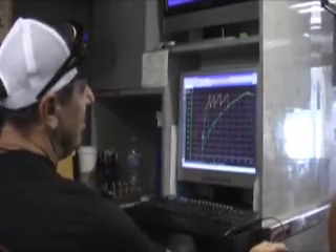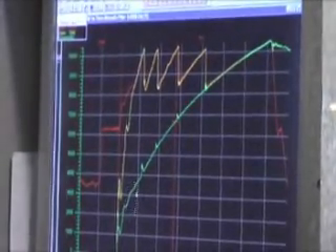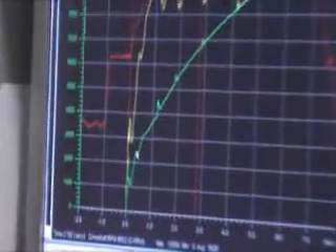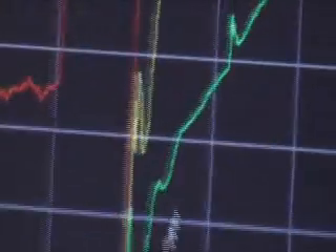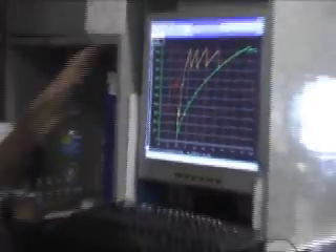You can see how smooth the track is here. We got a little bit of clutch slippage off the starting line and that's where we lost a little bit of ET right here — just a little lazy. We don't want to see that little dip in there. That's the driveshaft — it checks and then stops, and we don't want that check here. We want that to be a smooth track — you've got to go right through there.